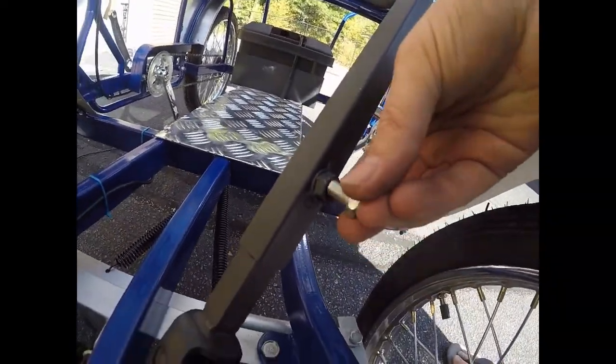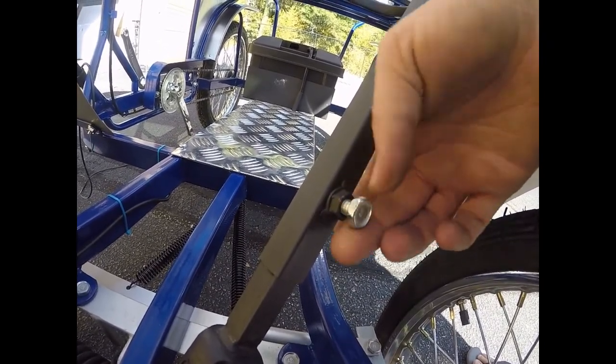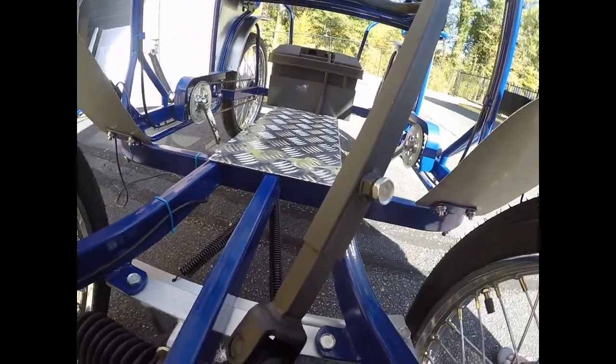Once all that's complete, put a little holder screw right in here. And one of your short ones will do. Let's just get it held in place so that you have the length right. One thing to note when you're tightening this, don't go all the way down, because now you're going to be trying to tighten the part that's welded to that. You want to make sure your socket is just on this part of the screw. That way you can get that piece tightened. Otherwise, you're going to be fighting against the weld and potentially break it there.